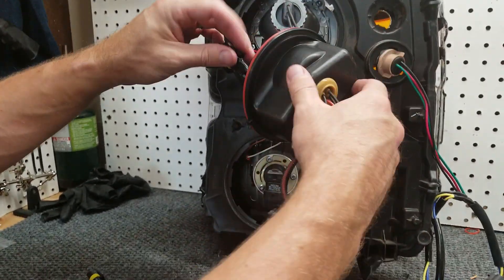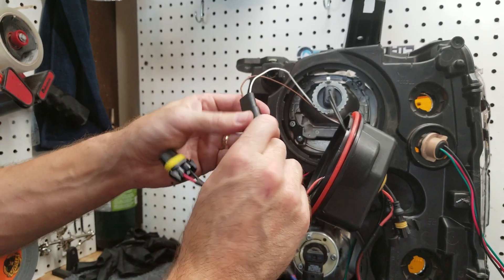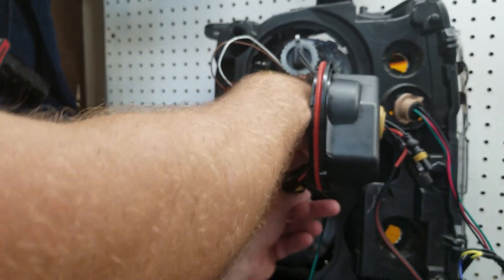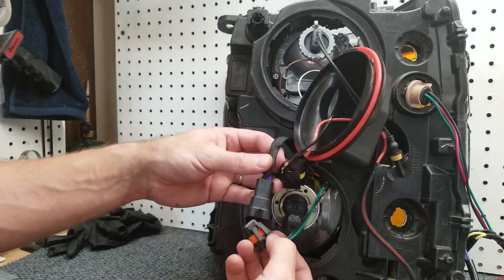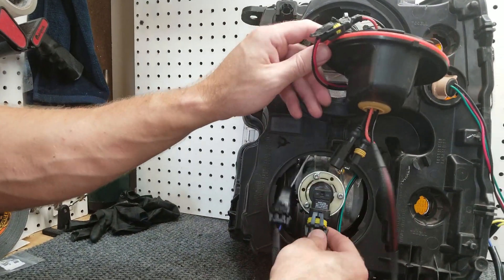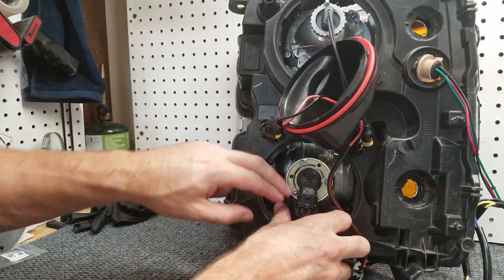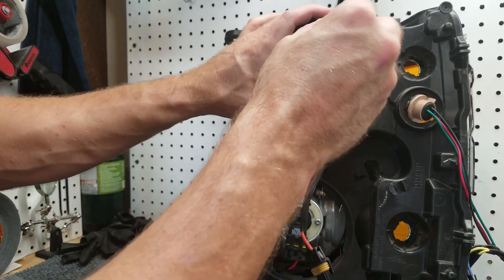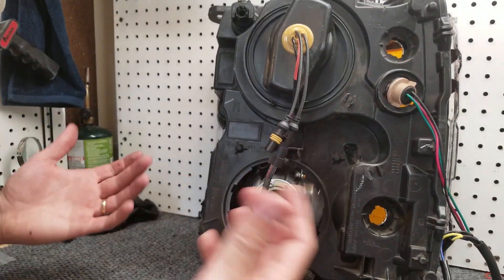So, low beam to this connection here. Next for the bi-xenon: take one end and plug that in — doesn't matter what color, it just clips in. Then feed the rest down through to the bottom. Undo the high beam bulb plug and plug it in here, and you should have the other end right here — plug that back in. That's your high beam splitter; it's going to give you high beam. Tuck these wires back in. Put your cap back on, pull the wires through, and that's it — no modification to this cap. You're ready to hook up your HID.